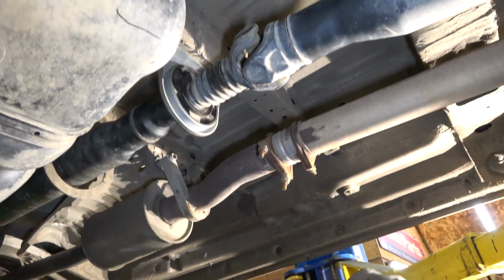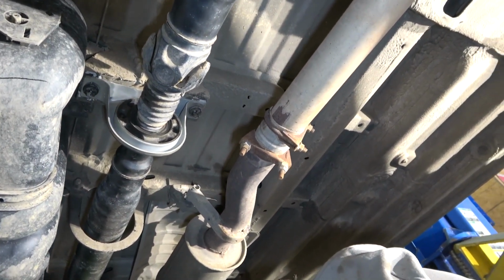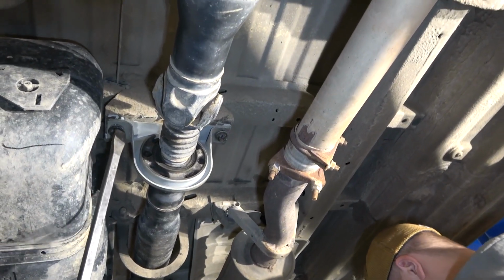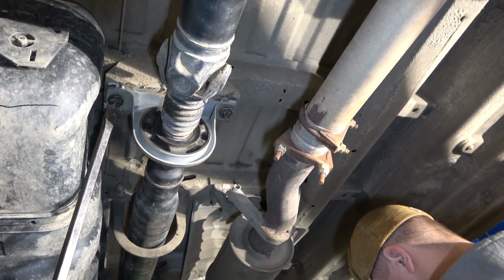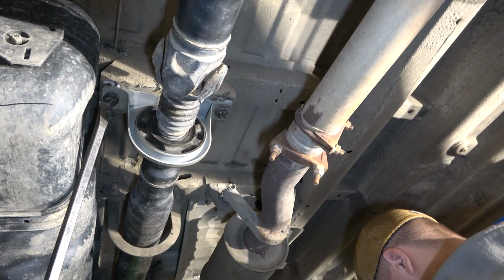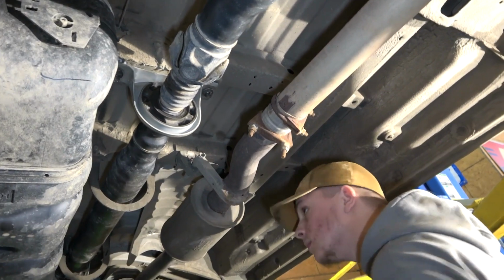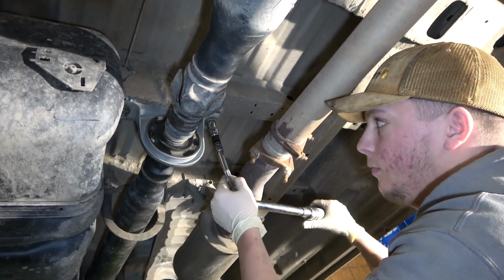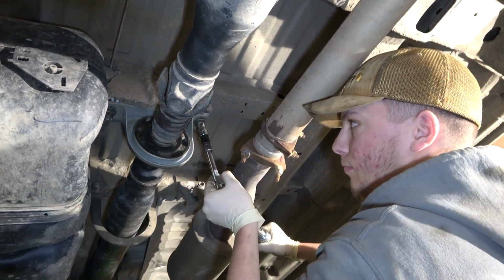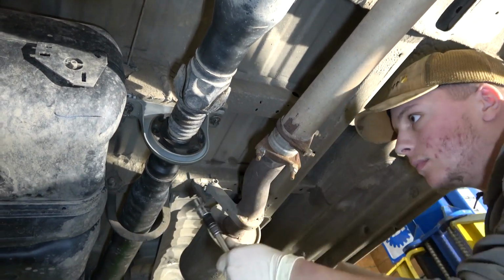Okay. So the torque spec for the support bearing bolt is 70 foot-pound, and these holes over here on this support bearing are elongated, so we made sure that they are centered over here with the bolt. So now Kyle is going to torque these two bolts. We're going to torque them up to 70 foot-pound. That's good.